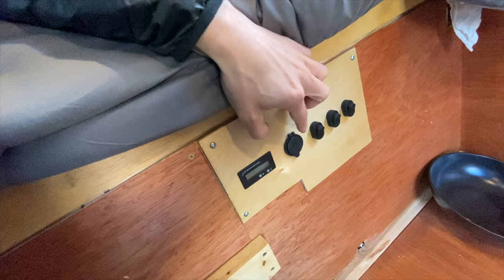All the lights in here are wired in parallel — is that hard to do? Absolutely not. All you need to do is run a positive and negative wire to every single light or appliance. These two are wired in parallel, meaning a positive and negative goes to the first one, and then the same positive and negative continues to the next. The only other thing I'll mention is why I didn't go solar: in BC we get one to two hours of sunlight per day on average in areas like Revelstoke where I like to camp. I'd be driving my truck way more than the sun would be shining, so charging via the truck made more sense. If I ever really need power I can just turn the truck on, though I've actually never had to do that.